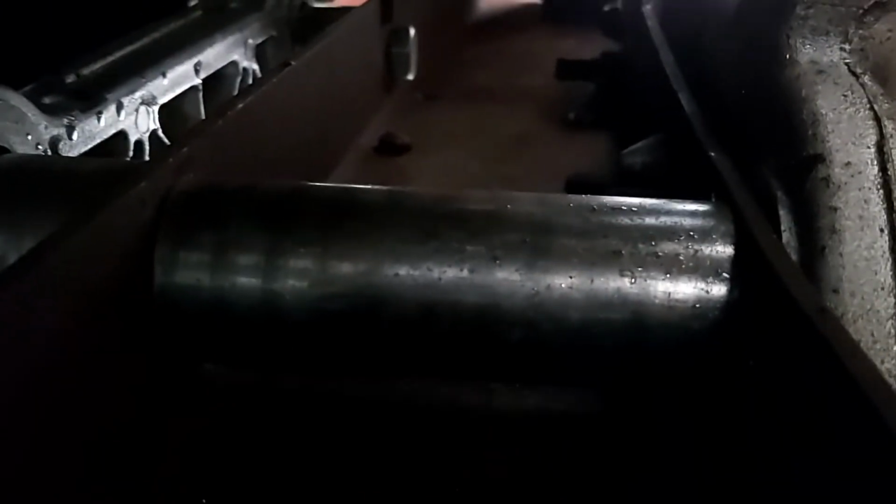And then on the inside of the chassis I've put these big spacer bars. Come on camera, it's not going to flash. Put big spacer bars in between so that the 16mm bolt goes through the top, the bottom, and catches the chassis. And obviously I've had to make spacers for the top as well, so these all bolt down and clamp up. And you can just see from the front that there's a cross member which basically runs across. This captivates that whole thing into a box.